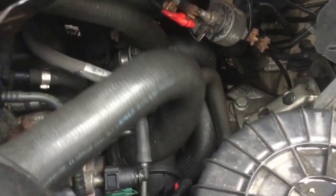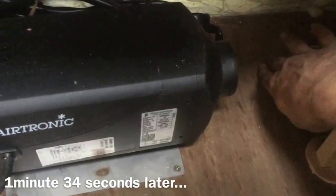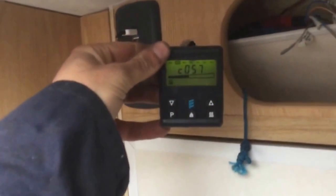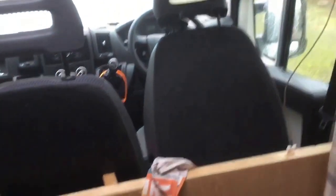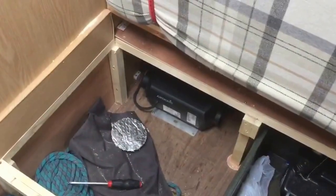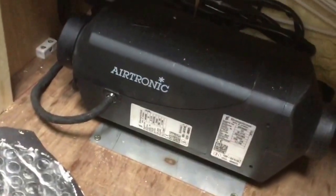Not feeling hot yet. There's our tick. This makes me feel that it's beginning to get hot air through the unit itself. I'll do a proper fire up in a minute. I've got the unit running without the engine on. I'm just going to have to take her for a run to charge that battery. I've charged the battery slightly — I've just left the van running with a brick on the pedal for 20 minutes. The unit's just beginning to fire up now, so we can hear the turbine noise.